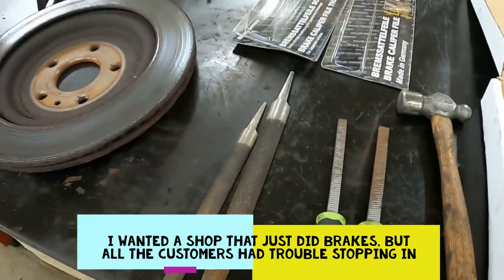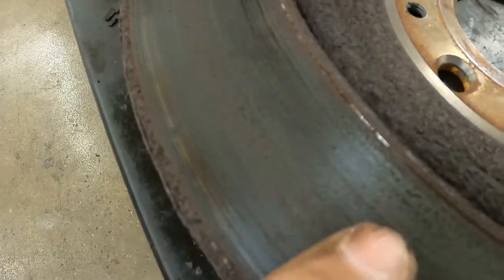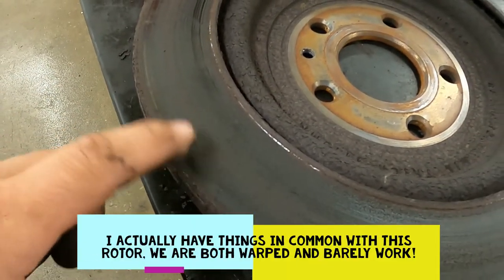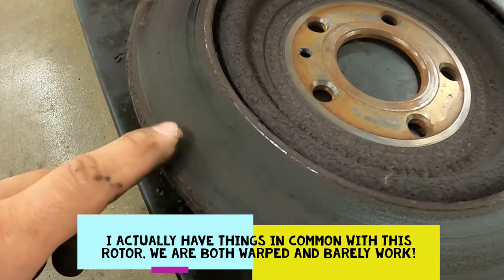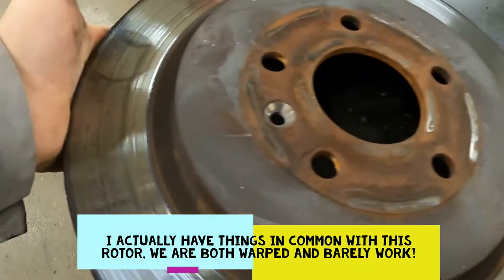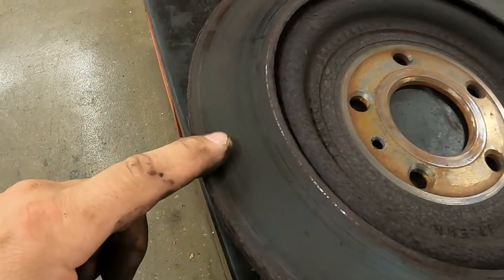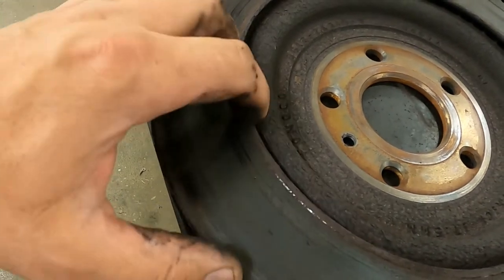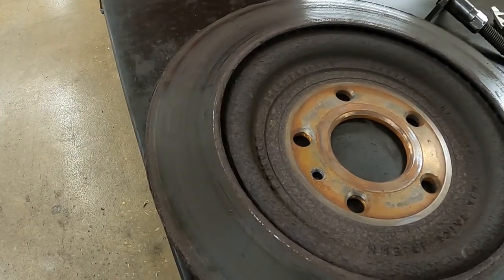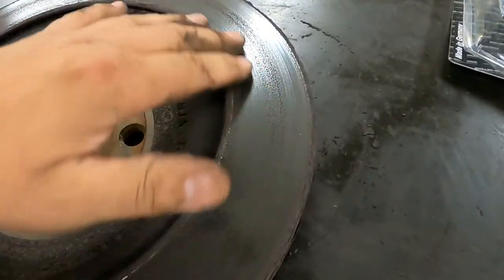While I'm sitting here, I've got this brake rotor — this is the back of the rotor and you can see this rusty finish on there. With some of these Fords, like I said, this is a 2019 with about 30,000 miles. On the inside of the rotor it looks like this because the rust jacking caused one pad not to move. What we're getting is they're rusting up and then delaminating — large chunks are coming off — and that's causing pulsation through the brake pedal, which seems to be the major complaint on these.